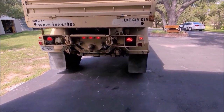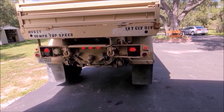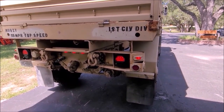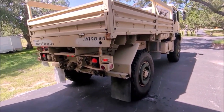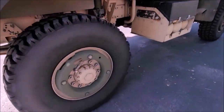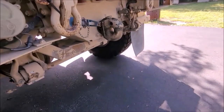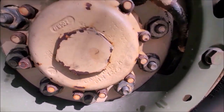I put 13 quarts in, got the plug back in, everything put away. I believe it's 13.05 quarts is what is supposed to go in there — the extra 0.05 is probably left in there. Inside the hole I just put my finger down and I could feel it, and the truck is at a slight incline forward so it should be good. I'm going to take it out for a ride, top it off with diesel, and then come back and check it again after it cools down and make sure I'm at a level spot. Swapping that oil is probably one of the easiest things to do on this truck. Just got back from my drive — good 30 miles round trip, mostly highway, so I got it nice and hot. Not seeing any leaks at the time being from the hub seals, nothing from the drains.